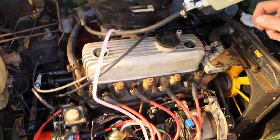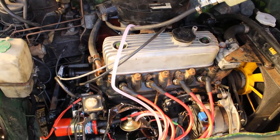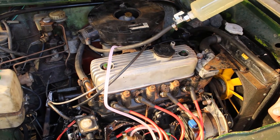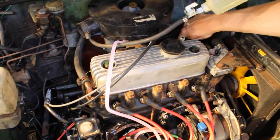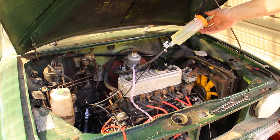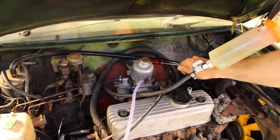We've got the auxiliary fuel tank set up as well, which is just a gravity feed tank — perfect for tuning. The reason I don't want to use the normal fuel tank is this car sat for over 10 years and obviously there's a bunch of gunk in the tank. I've already started letting some of the fuel flow out when I've turned over the engine and the mechanical fuel pump has kicked in, dripping it into a tray below — be careful with that if you're going to disconnect that line because you're going to get fuel shooting everywhere. I've got here rigged up the little auxiliary tank which is just a motorcycle tuning tank; you just run it direct into your carby fuel bowl. You might have to put a little bit of fuel down the air intake just to get the car going to start with.